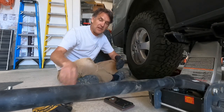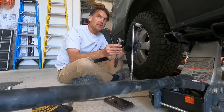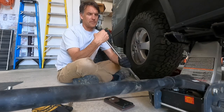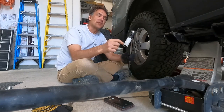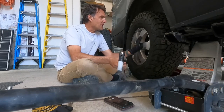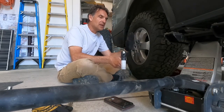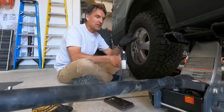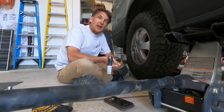You also need a big breaker bar or ratchet. I use both — the ratchet to help take lug bolts off when they loosen and put them back when still loose, then a big breaker bar with the appropriate 19-millimeter socket. This socket is specifically made for aluminum wheels with a plastic protective covering so you don't scratch them. Be careful not to just lay the wheel flat, as the hub area can stick out to the sidewall level and cause scratches — lay it on the opposing side or keep it standing upright.